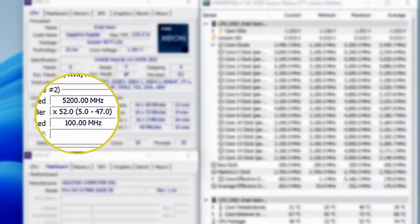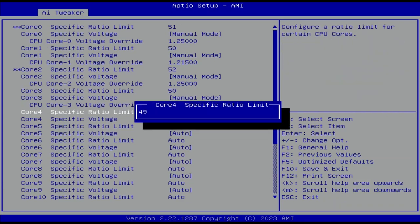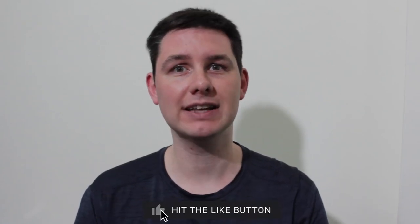Hello and welcome back. In today's video I'm overclocking the Intel Xeon W5 3435X all the way up to 5.2 GHz using the Asus Pro WS W790E Sage SE motherboard and EK Pro custom loop water cooling. We'll do that by manually adjusting the p-core turbo ratios, setting per-core ratio limits, and manually setting our voltages. I'll also have a quick look at how Sapphire Rapids overclocking works in general. But first let's start off with the hardware.